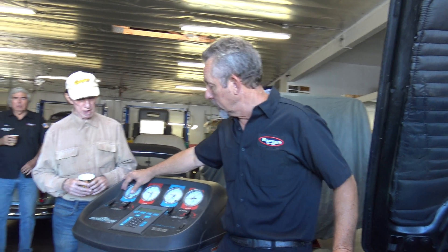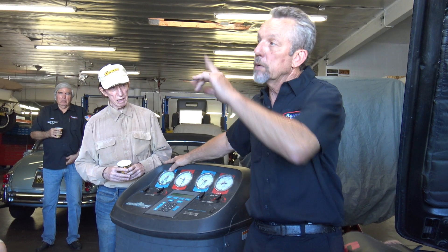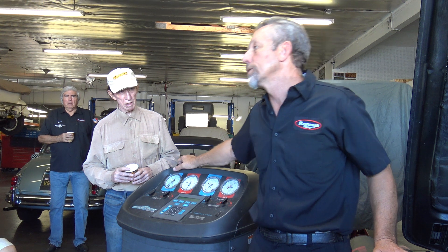When we say the performance is being affected, it's the cooling performance. I notice it's mostly at slow speeds — once you get up to speed on the freeway or cruising 50 miles an hour, it blows great, ice cold. But when you come to a stop and you're in stop-and-go traffic, it reduces a bit. There's not much you can do about that unless you convert the whole system to 134. The cost of R12, which is still available, is exorbitant — it typically costs me five times as much as the 134.